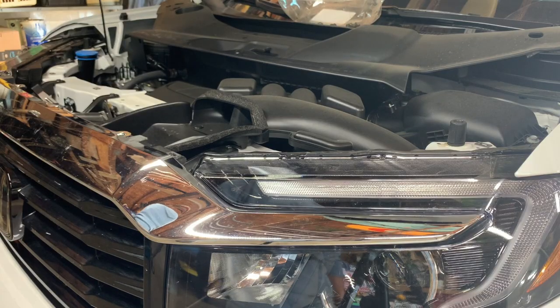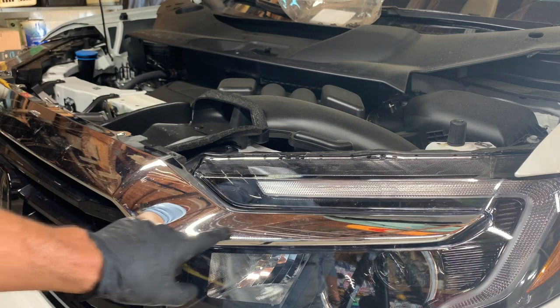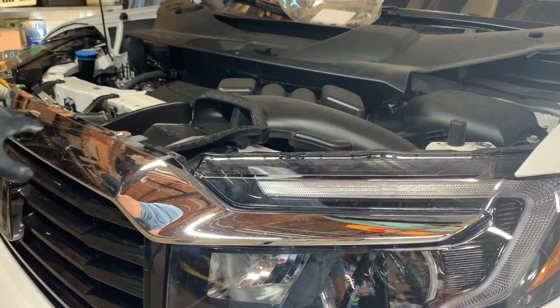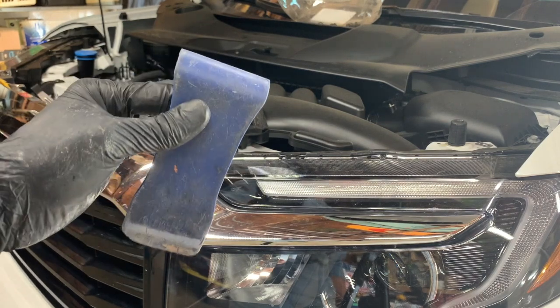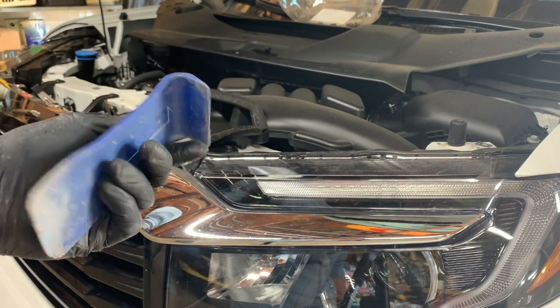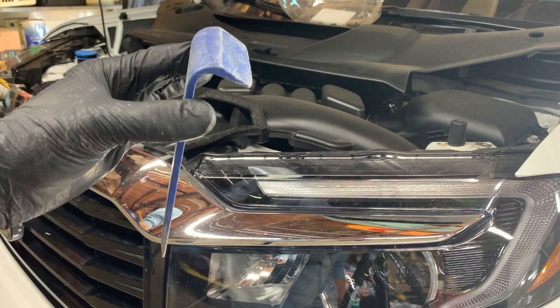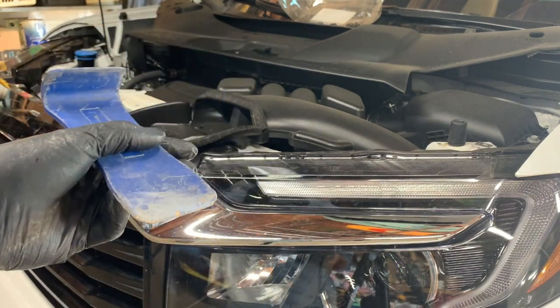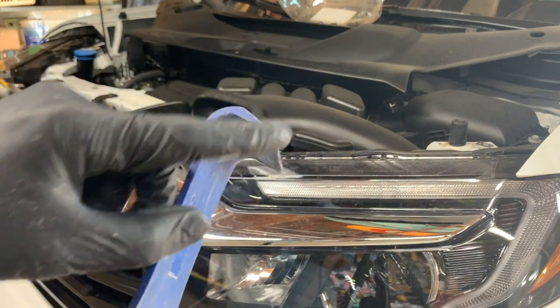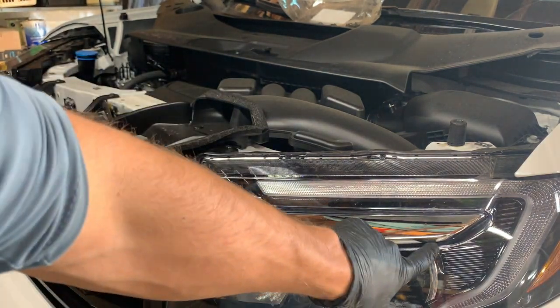The next thing we're going to do is remove this chrome strip here across the headlight and across the top of the bumper. To do that, we're going to need a plastic pry tool. You can get sets of these pretty cheap off Amazon, and I'll put a link in the description below where you can get these. So we're going to take the wide plastic pry tool from the set, and we're going to use the 90 degree portion here, and we're going to go up underneath the chrome.